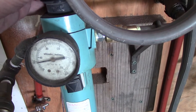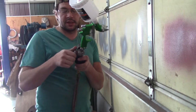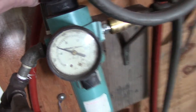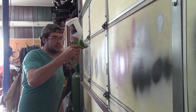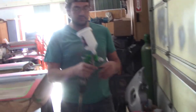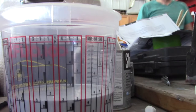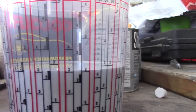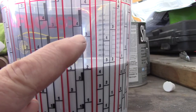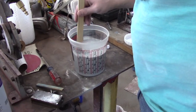I don't like the way this gauge is graduated. It's saying 20 right now, and when I pull it it goes down to 10 — we've got a bad gauge, something ain't right. The pressure you want is when it's actually pulled. All right, let's set it up and spray some primer with it. I'm right at that number three line. We need to mix four to one to one, that's what it says on the can. We have the other two chemicals to add in — one quart gets us up to three.